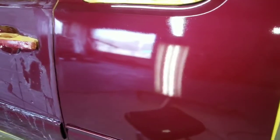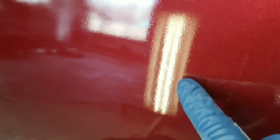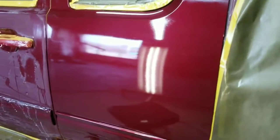It was cold last night. So the paint is still not fully cured, which is good and it's bad. You have to be careful, but if you look closely, we may still even get a few fingerprints in here if we're looking closely, but there, see, I pressed down, you got some fingerprints. This is a perfect time to color sand this, okay?